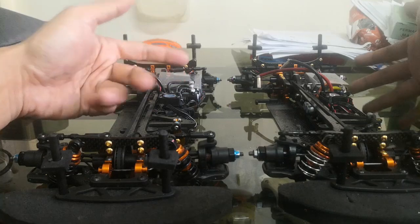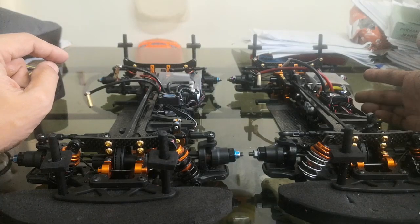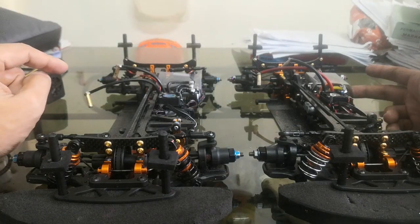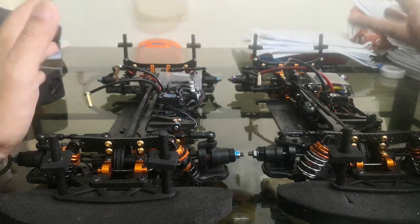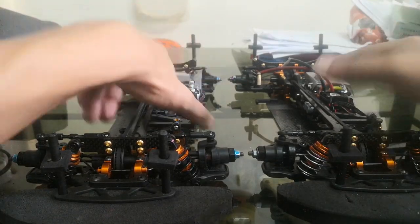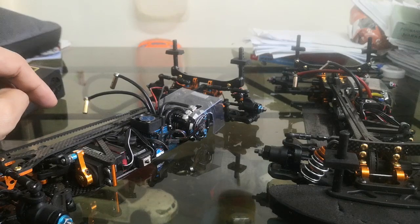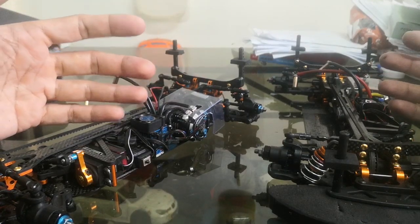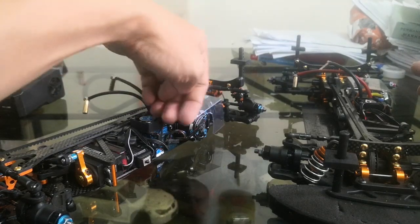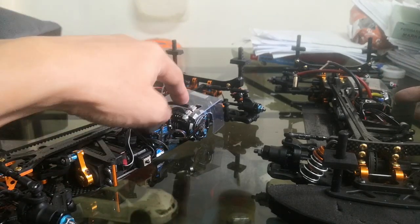The blinky class is of course no boost. Gearing FDR is 3.7, timing is 45 degrees, and I try to keep the motor temperature at 140 degrees. A big tip: the motor shroud really helps cool the motor. The cooler your motor, the faster you go — it's very cheap to make, just plastic cut to direct airflow right at the motor.